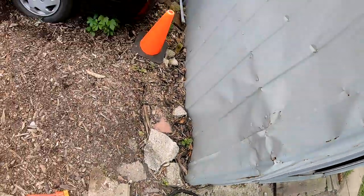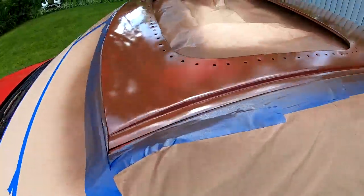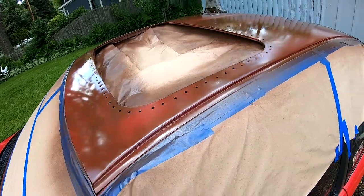Let me show you guys. Still got another 5 minutes, and I'll lay a second coat, a thicker coat. For your second coat, you want complete coverage, so everything that is not covered should now be completely brown. After that dries, we'll do our third coat, which is when you really bomb it. Whatever it looks like as you're bombing it is exactly how it's gonna dry. So if you see a little shadow or some overspray, you need to knock that out, fan it out. Otherwise, that's how it's gonna dry.